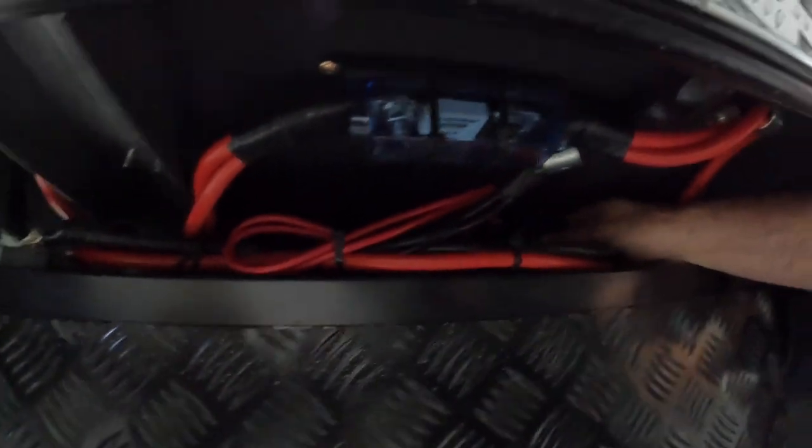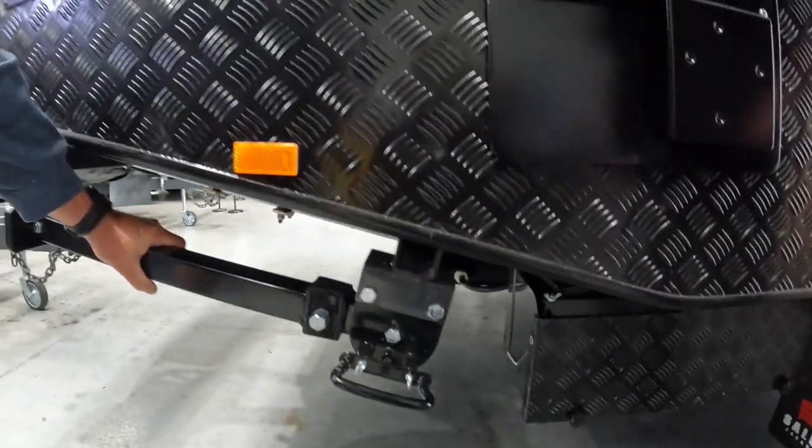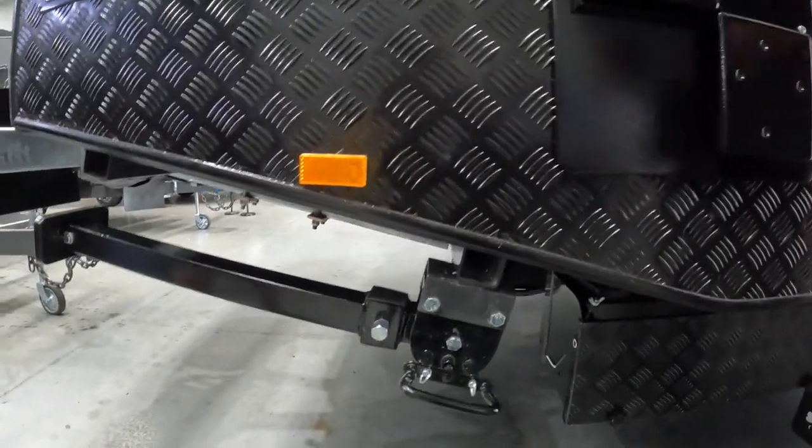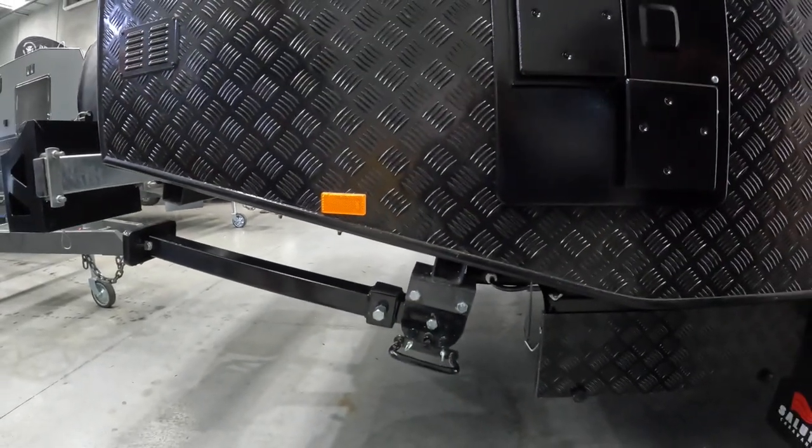We've got a fuse. Has it got a light on it? Yeah, the inline fuses. They're 50 amp. So have a couple of them ready to go. Get some 50 amp fuses. They're called maxi blade fuses. Maxi blade. And put your airbags off before you put your stabilizer legs down.